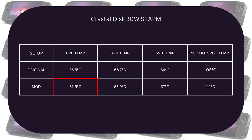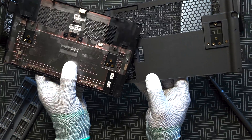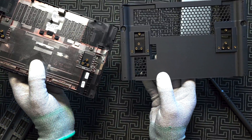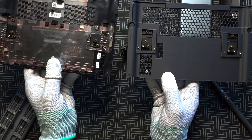On the bright side, for the modded cover, CPU temp is lower by about 4 degrees and GPU by 3 degrees. As for why the SSD runs hotter, I believe the original cover's metallic interior conducts heat more efficiently off the surface than the 3D printed plastic, even though the modded cover has air vents. I could be wrong, so please correct me on that.